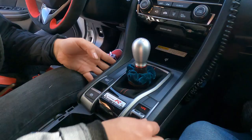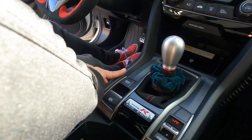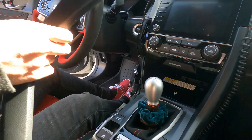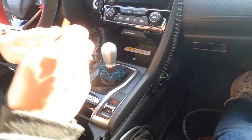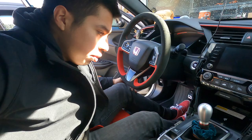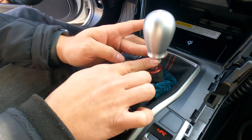You should be able to just put your pry tool in there to pop these panels out. After we got both of those removed, we're going to remove our shift knob. Drop the shift boot - this collar right here is going to be a 14 millimeter. Hold the shift knob, use your 14 millimeter wrench to break the shift knob loose, then remove the shift knob and the collar.